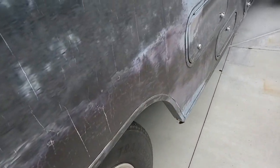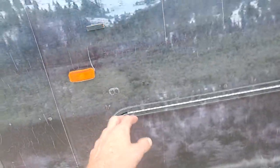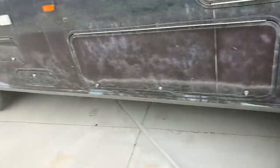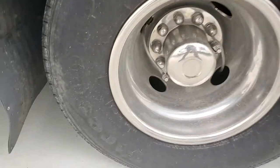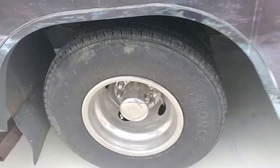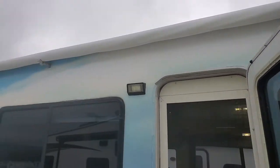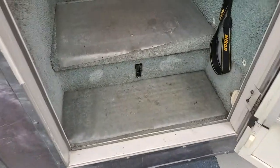We've got a little bit of delamination right over the wheel well. None of it is structural yet — if you keep it sealed up it'll do just fine. It's just bubbling from the glue releasing. There's an entertainment system behind here. Tire date code is 2019, so you've got fairly new rubber. These are 16-inch tires, so replacements will be reasonably priced. The awning material has been replaced and looks in fairly good shape.